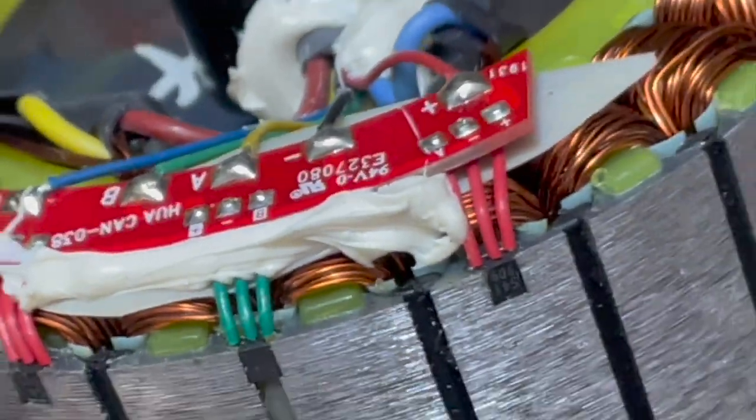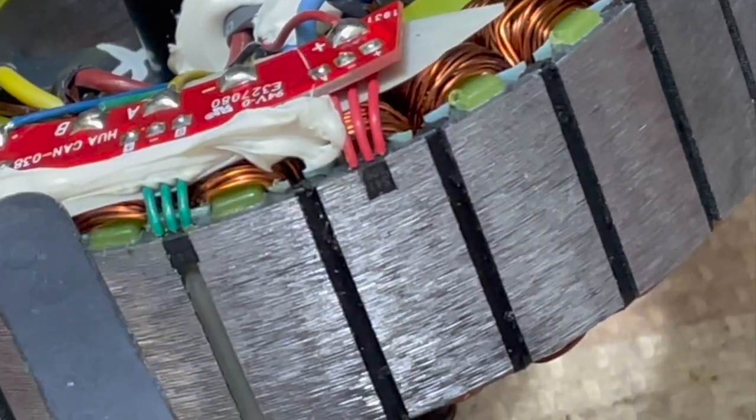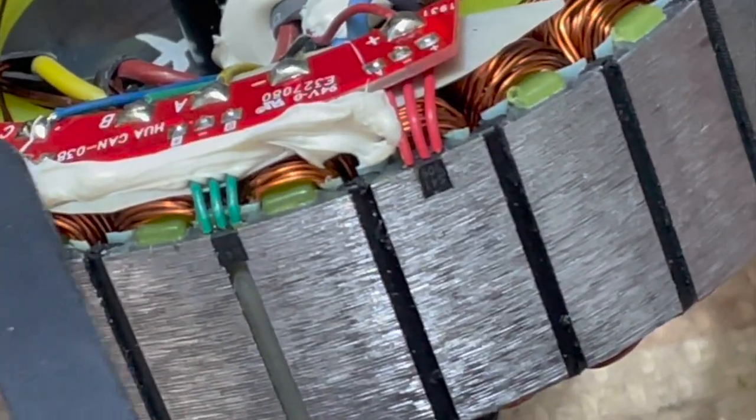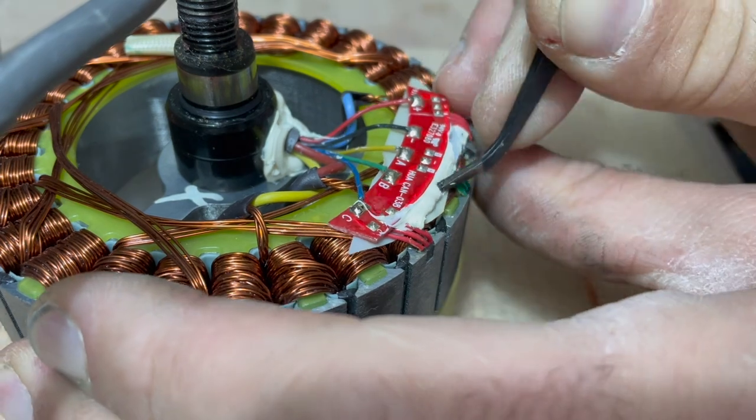Then I connect all three sensors to the PCB board with letters facing out and then just twist the middle sensor 180 degrees with marking on the sensor facing toward the axle, so the polarity of this sensor is reversed and the controller board is getting the correct readings.